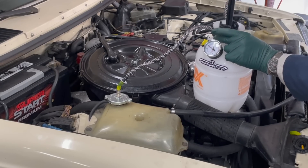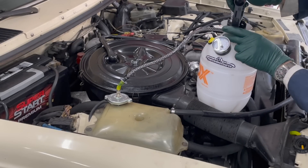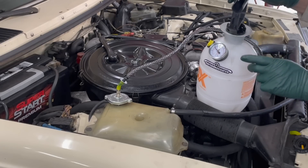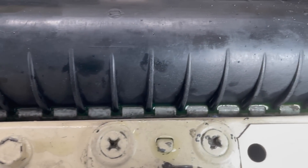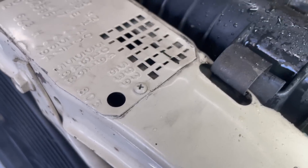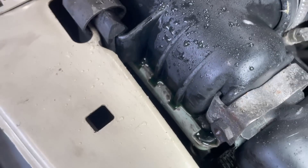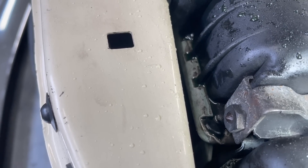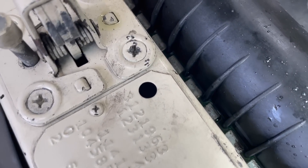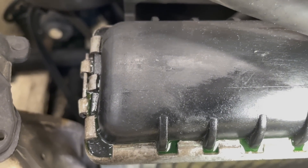I'll bring it up to 10 and then we're going to watch the needle for a second. Oh, you've got to be kidding me — there's noise over here, look at this. Pretty obvious where the leaks are — almost all the way across this tank. Look at this, it's popping and squeezing right in there. We've got a pretty severe leak. This was what was leaking on the ground from this top section of the radiator. It wasn't coming out of the core, it wasn't coming out of the hose clamp or the hose. It's a failed seal between the plastic tank and the aluminum core. Isn't that amazing — how quickly you can find a leak using this pressure tester.